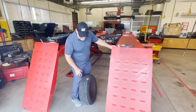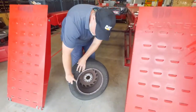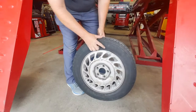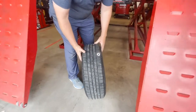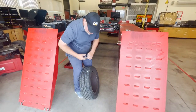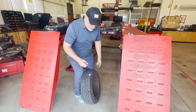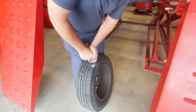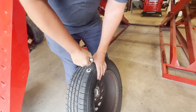Okay, since it's my tire, I'm going to go ahead and do it. The one thing we also should mention, tires are balanced. They have wheel weights on them, and sometimes on both sides. If you use a plug, you really don't have to rebalance the tire, and you don't have to take the tire off the rim. So you could, in theory, not even remove the tire from the car. That's why this is a skill that's worth having on video, because when you're in the middle of nowhere, you really don't want to take the tire off.